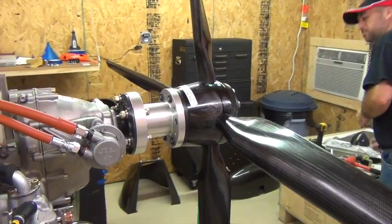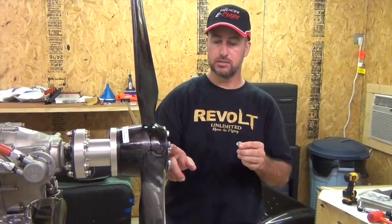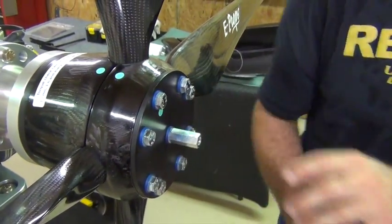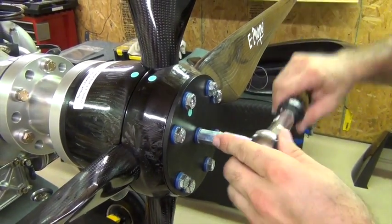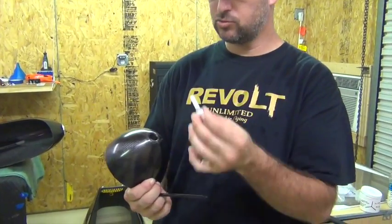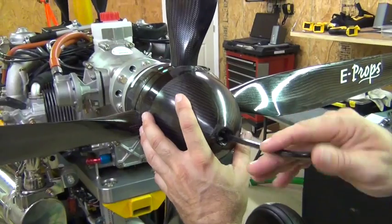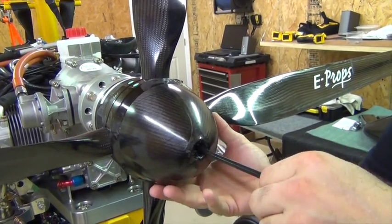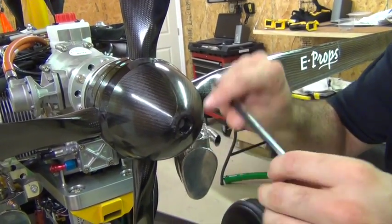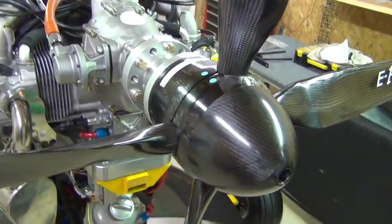Now we have opted for the optional spinner cone, which I think is really neat. If you don't have this, you would basically be putting on the NordLock washer and a regular nut. We're going to use this elongated nut here — this just threads right on — and we're going to torque this as well to 24 newton meters. Now we're going to secure our spinner with the nylon bolt with the O-ring that comes with it, using a six millimeter Allen wrench. I can't stress enough — it's a nylon bolt, don't try to use a torque wrench on this, you need to just snug it down using the small end of the wrench. Get that snug and our propeller is complete and ready for a run-up test.